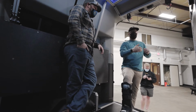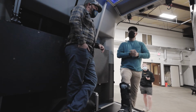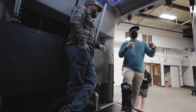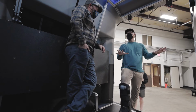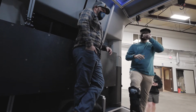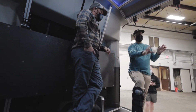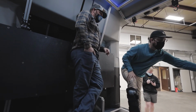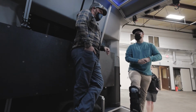You also have the off option, which would not allow them to ever communicate, which we don't really use in our application. Maybe if you were going in for service and they might be measuring voltage on your alternator, you might want to disconnect it so there's no issues. But that's the only time I can think of for the off function. And then let's say that switch fails, or it is not powered because power is too low. We made a little adapter in here, and we can get inside here and physically engage that as well, which does the same function as this switch.